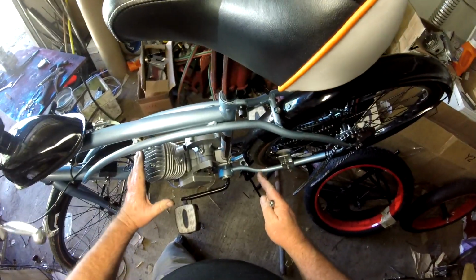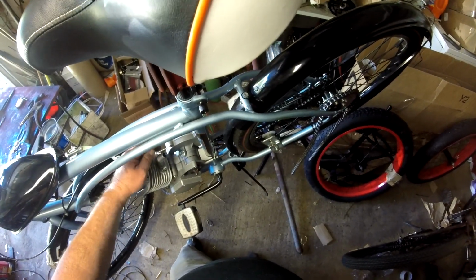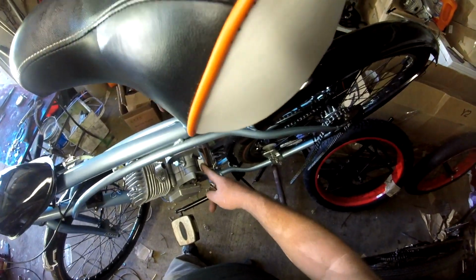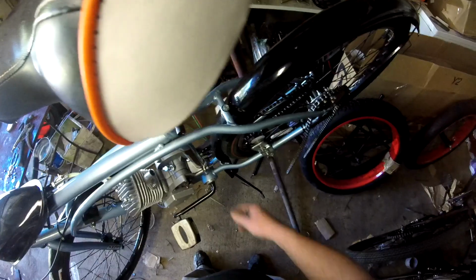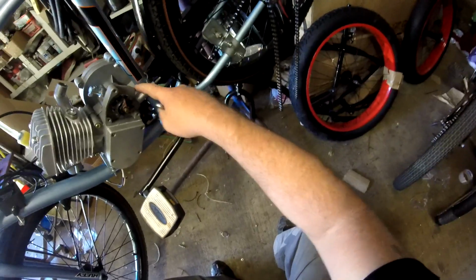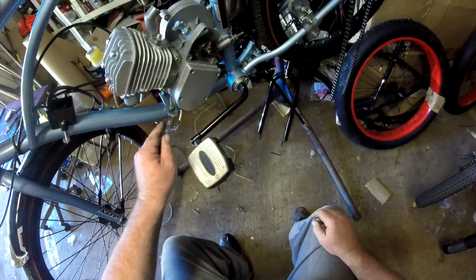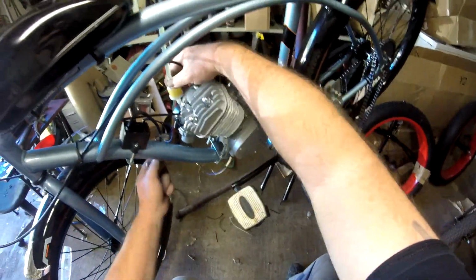Setting your motor up properly and having it mounted properly is your first job in a correct installation here. If you have it cockeyed here, cocked somewhat, you're going to have failure. If you don't have a good solid connection here and have it properly tightened up here, you're going to have your studs flex. They will break. As well, if you don't have a good firm seating here, you're going to have things off kilter here, and it's prone to breaking. So if you get this set up right at the first, you're going to have a lot better time, a more reliable installation here.